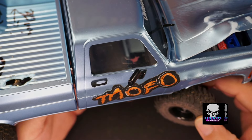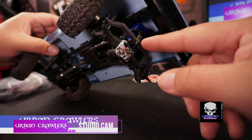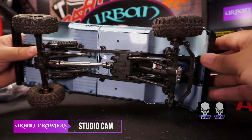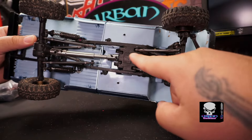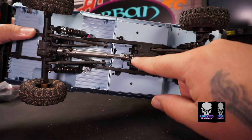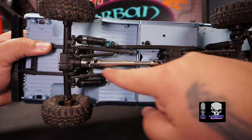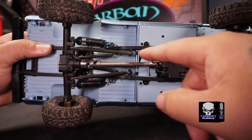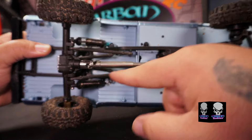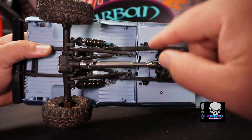If I had to say the most difficult part of this build, it was getting the axles to line up with the front wheel wells. It's a little difficult trying to keep the four links from the TRX4M and the skid plate in place to get the axle to line up. For the rear, it was all complicated because the four links I had to use were the TRX4M high trail, and then the axle I got was for another build — it was a little too big, but I got it to work.